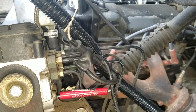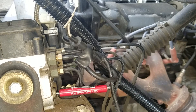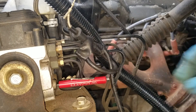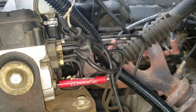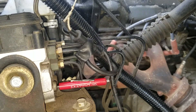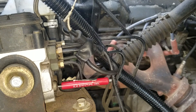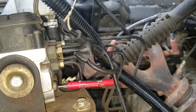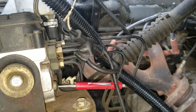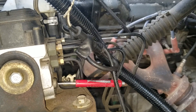So the quarter inch or 7mm is normal, and the brake pedal is holding pretty good right now. Let me press back on this — press back — it barely moved, so now I'm going to press very slow on the brake pedal to duplicate the customer concern, getting to the stops and pressing very, very slow. That screwdriver shouldn't move more than a quarter inch if this unit is good.